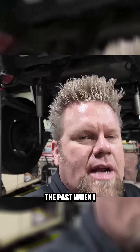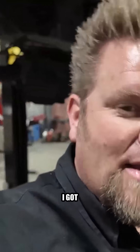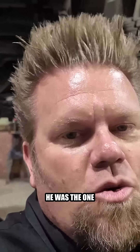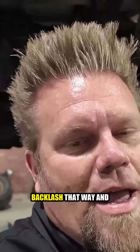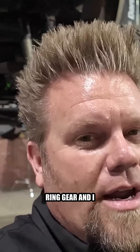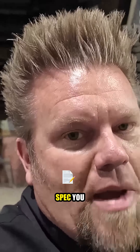I mentioned in the past when I did a Toyota rebuild differential video on this channel, and people asked where I got that information. I got it from an old book by Randy Lyman from Randy's Ring and Pinion. He was the one who first put out that you could measure backlash that way. I verified it — I took a Toyota differential, got my 90-degree dial indicator in on the ring gear, and was able to compare it to the measurement on the yoke, and they were within spec.